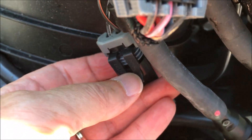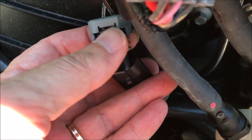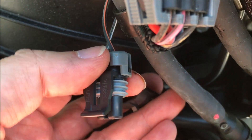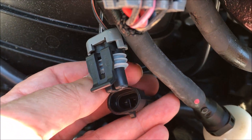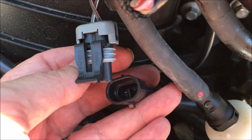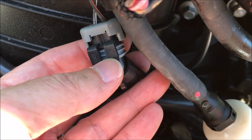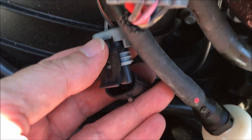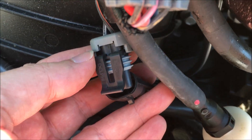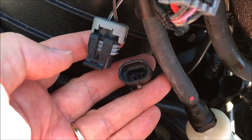The connector is connected to this one here. An easy way to test this problem was simply: I started the engine, took it out on the lake, and while it was running I disconnected the neutral safety switch. Voila — when I gave it gas it went beyond 3,000 RPM. So it's definitely the neutral safety switch, or TPS switch — I think TPS sensor is what they call it too.